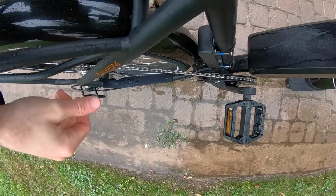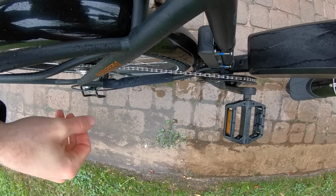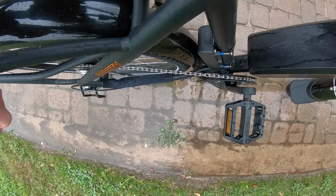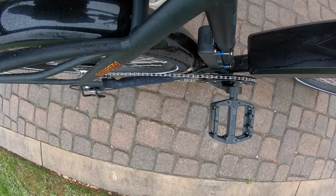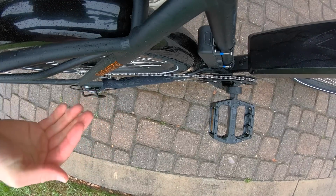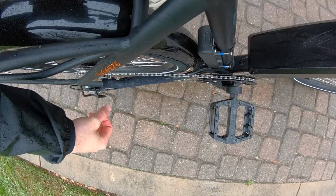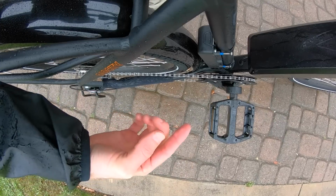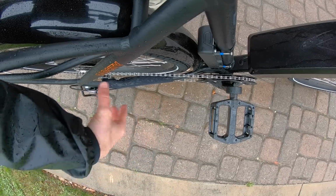With the throttle completely open going across the grass back there, I was at around 13 miles per hour, so that's your force power on this thing. And now I'll probably do a top speed test just on the concrete. There we go. I got it up to 21 miles per hour. And then there's the drag. It introduces a little bit of drag that's kind of noticeable. It's nice to think that I'm putting energy back in the battery pack, but for people who want to go really fast, that's one of the trade-offs with a gearless direct drive motor.